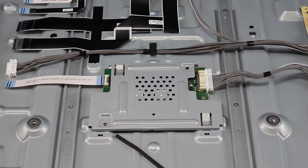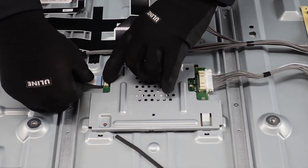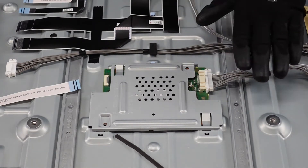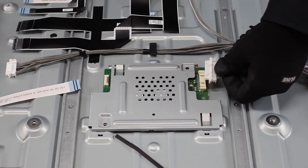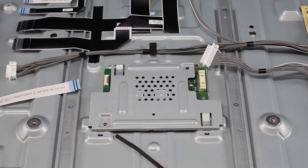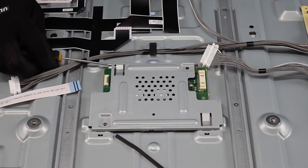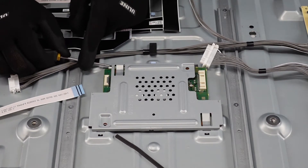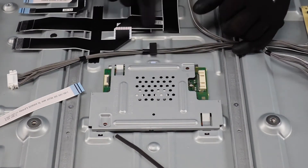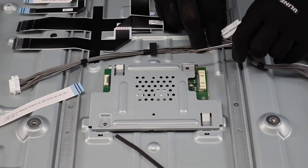Moving on to the LED driver. This ribbon cable — just like before — press down on that metal plate to release it and pull the ribbon cable right out. This connector looks like you want to pinch it on the sides, but you don't. Right here in the center you can see your lever: press down and pull that directly out. At this point there are no screws holding this into place. Get a small flat head screwdriver — there are two clips on this side. Get behind them and pop that metal away from the clip holding it in place. Also be careful because there is a hole here directly back into the panel; if your screwdriver goes through there you will completely mess up your TV.